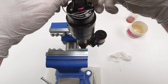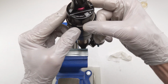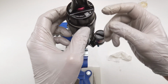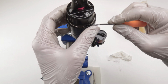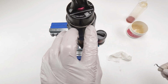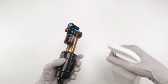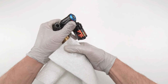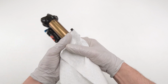Grab our retaining ring. What we're going to do is push them into one side where the notch is, underneath. Spin them around, underneath the next one, and there we go, right? Now we are in. Then we're going to take a pick. We're just going to bring it around to the outside out here somewhere. This way our notches are protecting it. Next up, grab some alcohol, coat them well, and we clean off all the excess grease and oil.